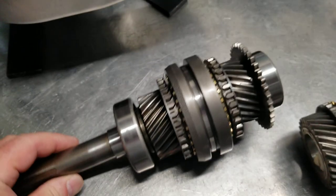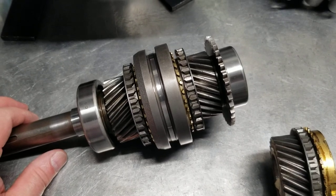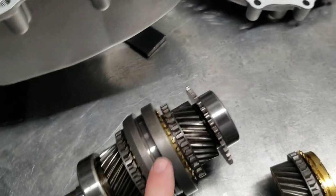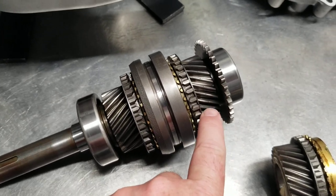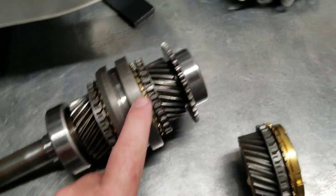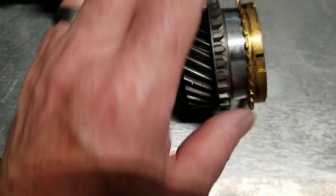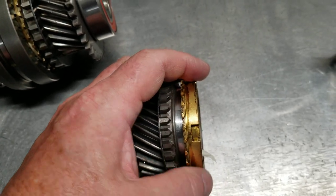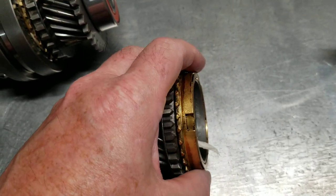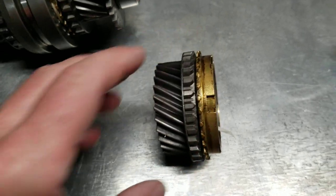What I mean by that is, if you're rolling forwards and you're not fully stopped, your synchronizer ring, as it's trying to migrate from the synchronizer hub over to the gear, is actually trying to slow the vehicle down. I was able to save this gear, but on this surface it was all burnt up. And this ring is just a mess — it just squishes right on there and makes contact.